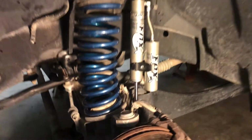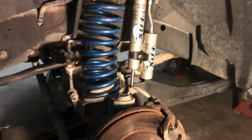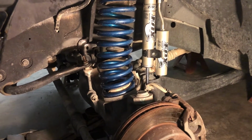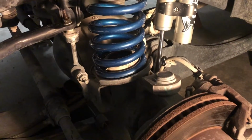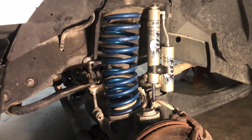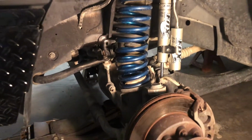Alright, I've got this whole side put back together. The coil on the driver's side I think has just about as much bow, if not more, than what the passenger side has. I don't really know if it's supposed to be like that or not. Put the wheels on, put the weight of the truck down on it, and see if it ever straightens out any. Might need to take it out and spin it around. This kit is used and I don't have any instructions on it. It's kind of hard to say. Maybe somebody could leave a comment and tell me if they know better than what I do. Buddy said it might be a BDS kit, but we don't really know for sure. The guy that bought it can't remember. Since it's powder coated, if it was a Thuren, it doesn't have any kind of tag left on it.